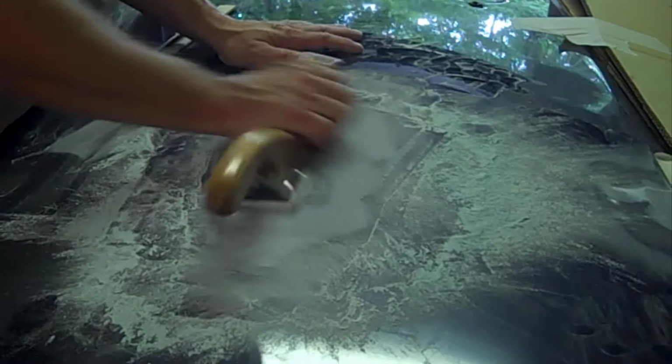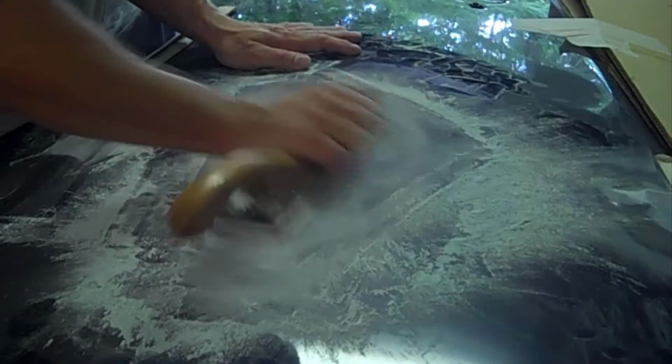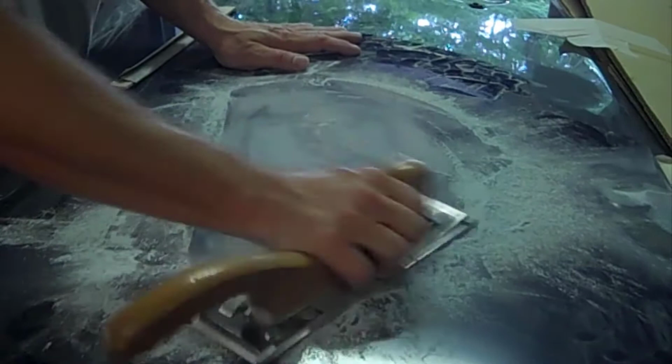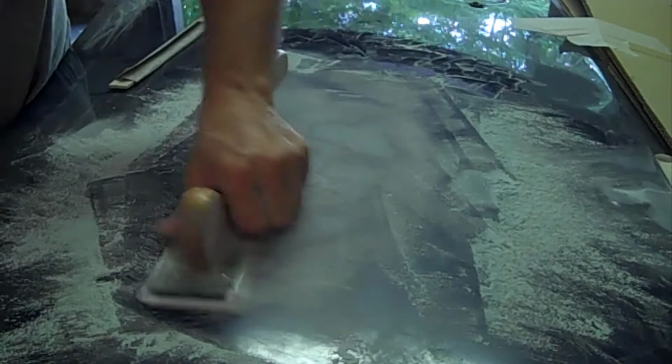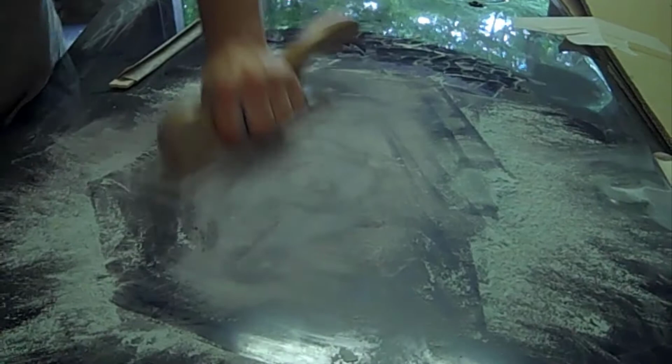So you can see how it cuts. And plus this picks up, so you're ready to get scratches. Now granted, when I go put that body filler over it, I'll be using 80 grit again to knock it down, but not for the main thing. I'll just knock it off at 80, and then I'll start jumping to the finer papers. Then I'll run this way, just to find the contour of that door.